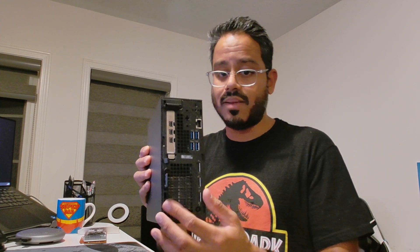You plug in your AC adapter — either 180-watt or 240-watt depending on your config. From a speeds and feeds perspective, the 3260 Compact Workstation can support up to a 13th generation Intel Core i9 processor, 64GB of DDR5 memory, and up to a 3000-class NVIDIA graphics card at launch. Nowadays you'll see it with the T400, up to a T1000, or even a brand new AMD W6300. You have a slew of USB Type-A's and Type-C's, RJ45, full-size DisplayPorts natively, and discrete graphics options.